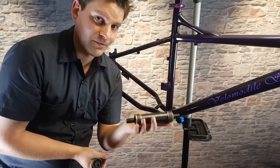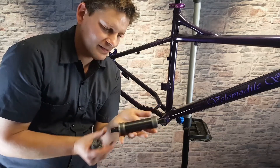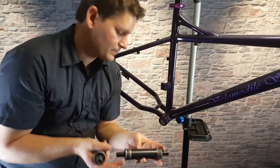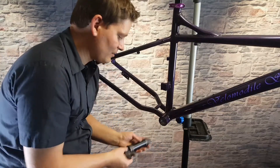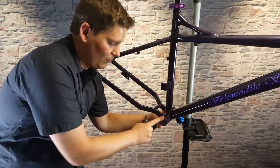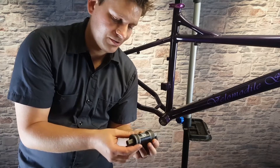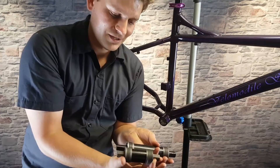In this video we're going to cover the installation of a threaded bottom bracket — this is what we're going to use for this bike. There are different widths: you can find 120 millimeter, 100 millimeter, so be aware there are different sizes. Just saying 'fat bike bottom bracket' is not going to get you the right thing — make sure it matches up to your frame. You can measure the width of that portion of your frame to make sure it's the right one. Looking inside you can see the threads. This is a smaller bottom bracket typical of what you see on a bike with much narrower tires, so there's the difference.